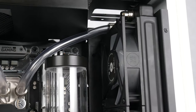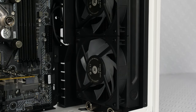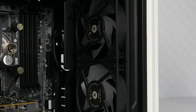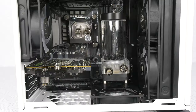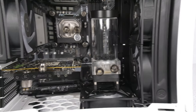Choosing the maximum size and thickness of the radiator that can fit in your case is always recommended. This will bring lower operating temperatures and lower noise emissions, which are the key features of custom loop liquid cooling. The same goes for GPUs — a 120mm radiator can handle it. Make sure your case has additional room to fit the pump and reservoir, or the reservoir-pump combo unit.